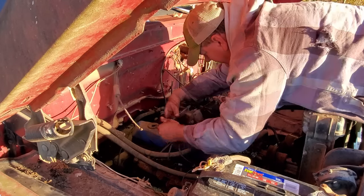We're going to go put this carburetor on that truck. And if this carburetor makes that truck run better, then I'll say that throttle shaft play is the issue. And it very well could be what's wrong with Dumas, because it's got about the same amount of play in the throttle shaft too. And I will say this, if this fixes that truck, it's going to get put on Dumas to see if it'll fix it. Anyway, let's head over there and put that carburetor on.